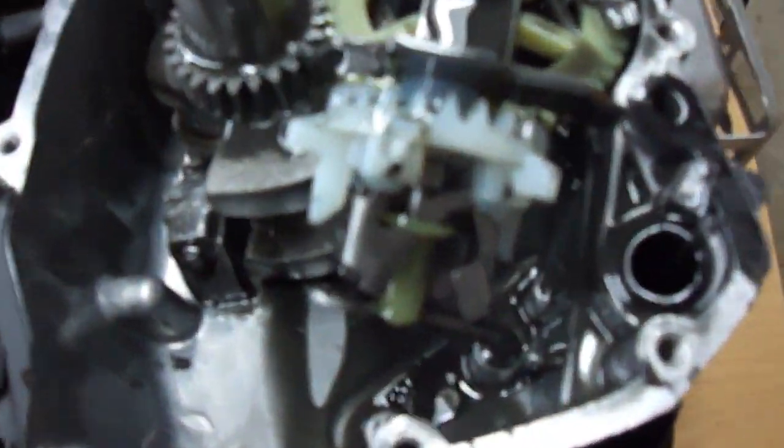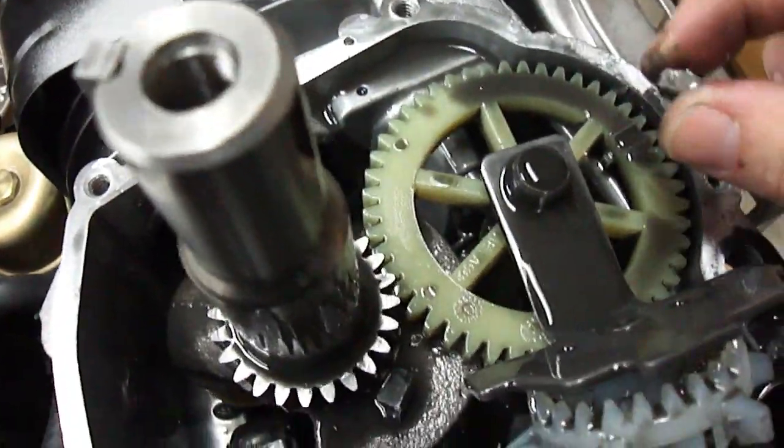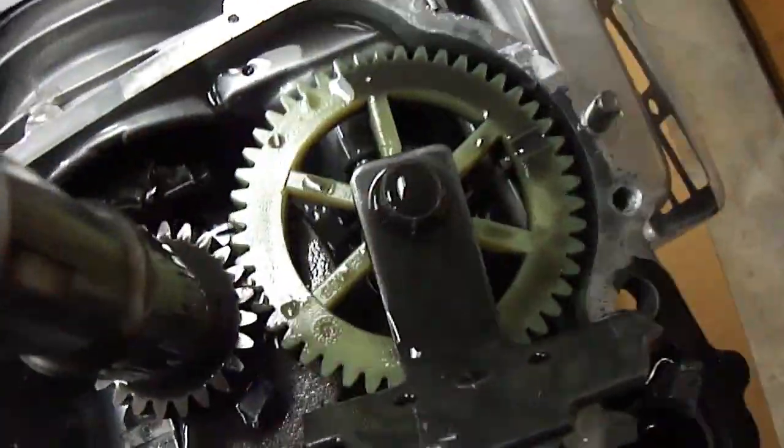It's definitely broken in there. As you can see, the oil wasn't too dirty — it's a little light. It's really quite a small engine when you look inside. It doesn't look like the crankshaft is too badly scored. Lots of shredded metal in here, like right here, and lots of it at the bottom.